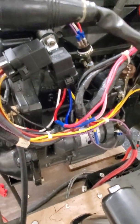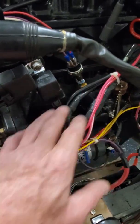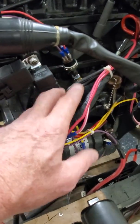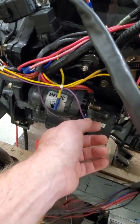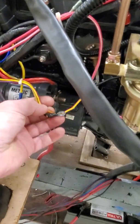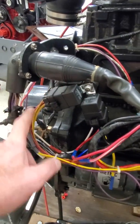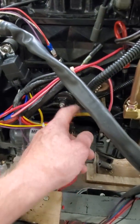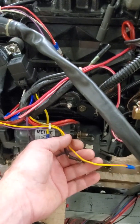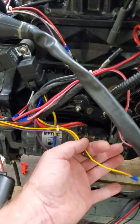The excitation circuit — now what we need to do is excite that relay and energize it. The way I wired it up, with the three-wire one, I have the S terminal for the starter. What I ended up doing was coming off my starter solenoid. I've disconnected the starter solenoid wire that comes from the starter slave relay here — that gets power from the key switch, energizes this relay, and this relay then sends power down and energizes the starter solenoid, which sends power into the starter. So I'm going to piggyback off that wire and connect those two to that starter relay in the back — those are the small yellow and red wires.